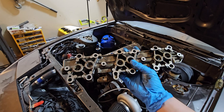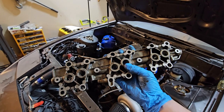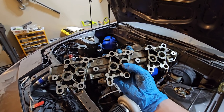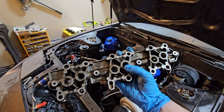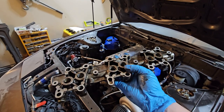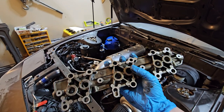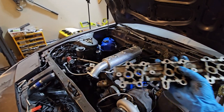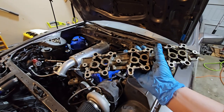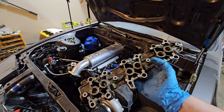It's going back in with the 290s that I have now, and hopefully it's enough to make sure that these don't tick. This is an absolute must to do if you have a 290 cam — you cannot get away without doing this, otherwise they will tick all the time. There's not enough adjustment in the lifter. The 280s are probably right on the edge for needing this. The 270s shouldn't, but you never know depending on how they were reground. So yeah, if you've got cams in your VG30 and it's ticking — lifter tray mod, 25 thousandths of an inch on the bottom side on the pads.